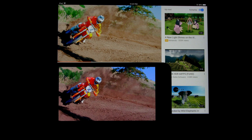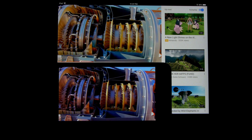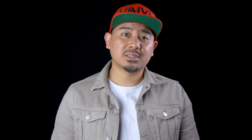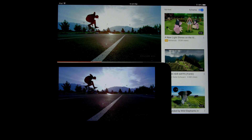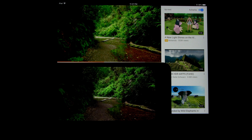There are technical differences between the LG screen and the Samsung screen that causes the differences in the way they render colors. It's most noticeable in reds and yellows. There's only so much that you can do using software tweaks — if the hardware can't output a certain color at a certain brightness, it just can't do it. If you're willing to root your phone and install a custom kernel, you can use an app called Kcal that allows further customization. That's a big commitment for me though. I want to run my Pixel 2 XL stock for a while. I'm sure I'll root and install a custom ROM at some point, but not now.